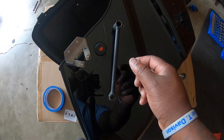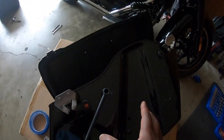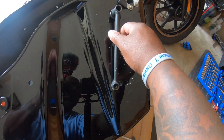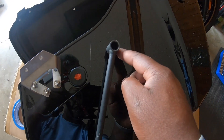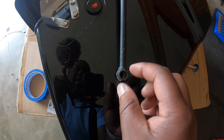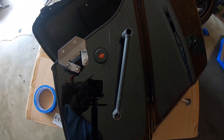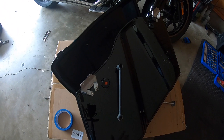These are the brackets for these bags. My holes don't line up with these two holes since I have a Suzuki and these are Harley bags, so I have to drill a hole here and put this bracket here, and another one goes right here and mounts to the side of the bike. I had to drill a hole here, drill a hole here, then run the screws through the inside to the outside — it's got a little screw fitting that holds them pretty good. These brackets came with the bike that had the Viking bags hooked up.